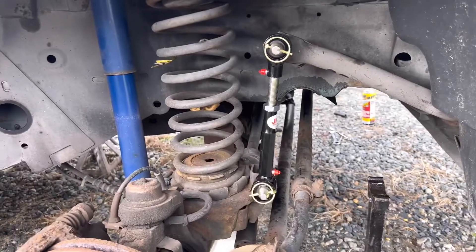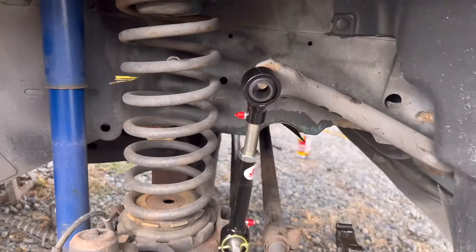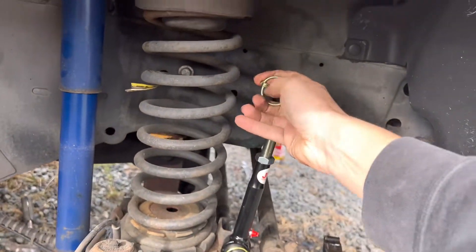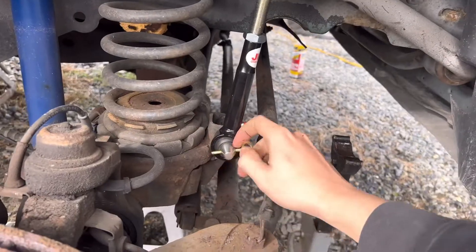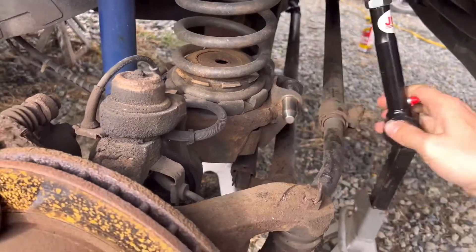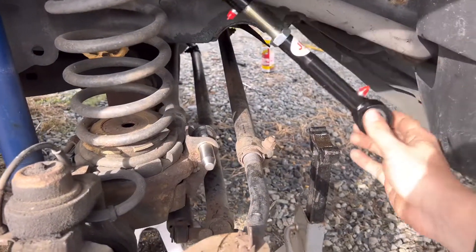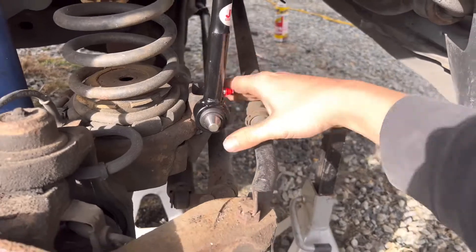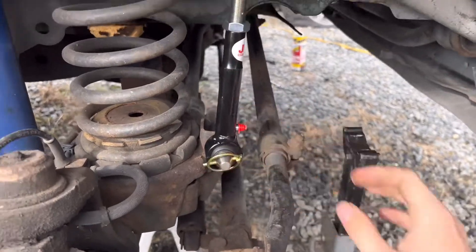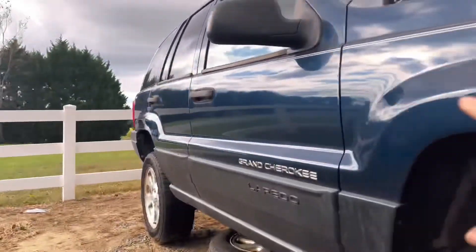To take them off, pop the pin on either side and pull the link out. My plan is to disconnect from the bottom — similar to how we do it on the Wrangler — pop this off, then mount another one of these studs up somewhere to tuck the link up so it won't hit anything or be in the way while off-roading. When you're done off-roading, pop it off that stud, put it back on, take your pin, close it shut, and repeat the process on the other side. That's how you install the JKS quick disconnect on a Jeep Grand Cherokee.